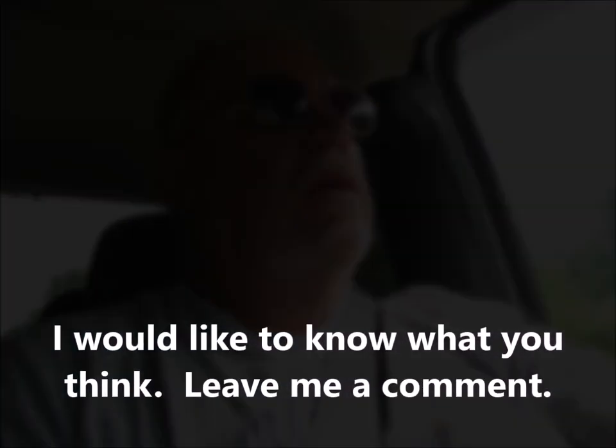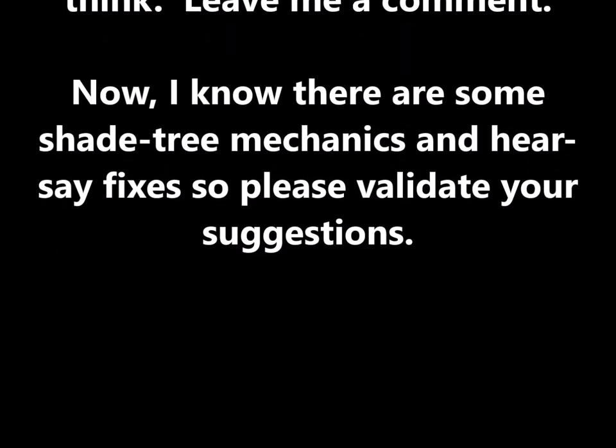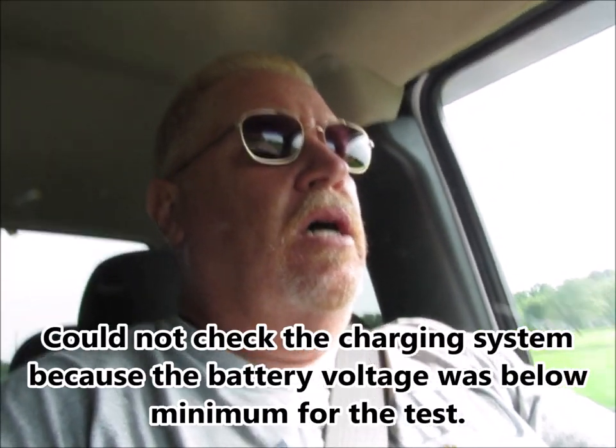Truck ran fine. I had them check the battery — it was at 42%, so the battery is discharged quite a bit, still enough to start the truck just fine. But the battery that's in the truck is over three years old, and it actually has a date sticker on it from when it was purchased. Thinking the battery is going bad. I'm really not sure if the battery terminal was a little loose, because it seemed a little loose when I took it off originally, and that might have been the whole problem. I haven't replaced the battery yet, but just driving it around for a couple of days to see if the battery will recharge. According to the gauges inside the truck, the alternator is working just fine, so we'll see in another couple of days.